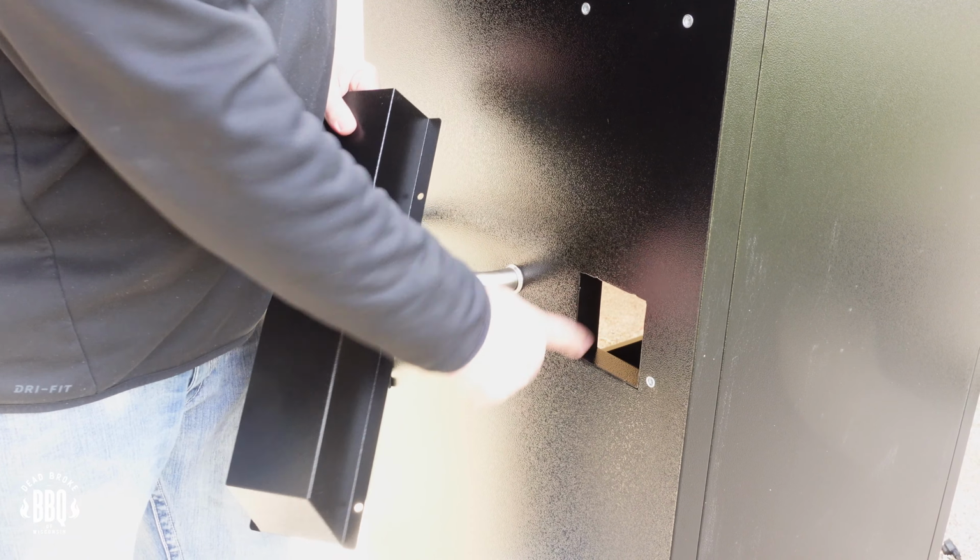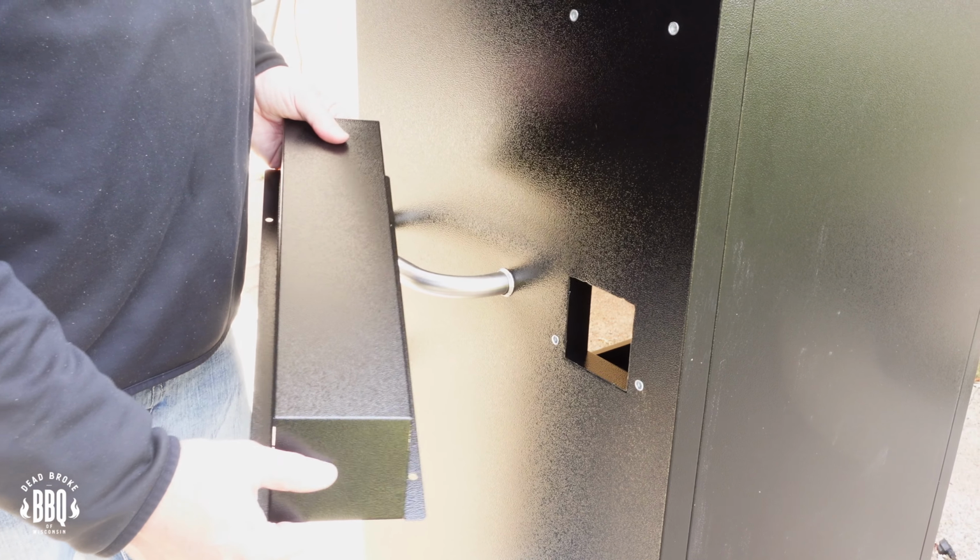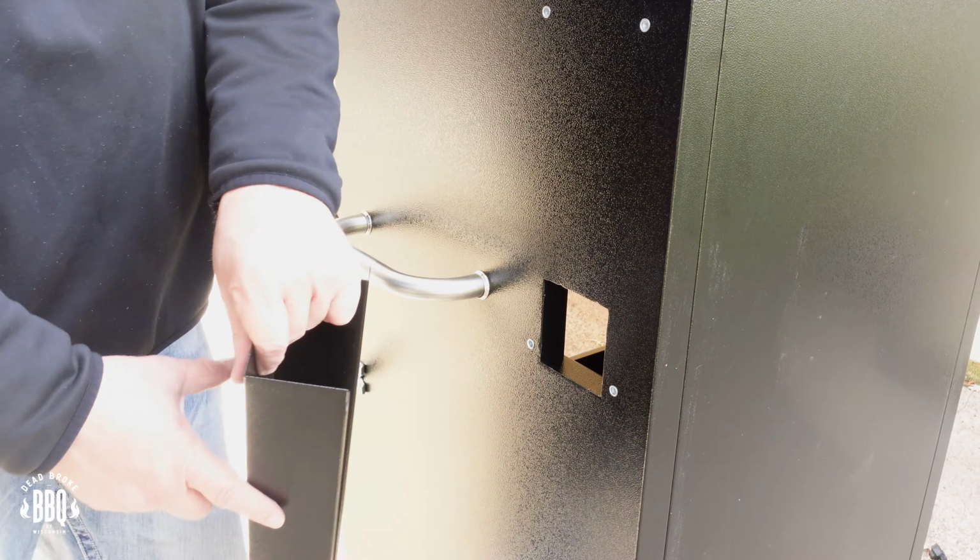Now here's the hole from the chamber, but you want to make sure that you have the closed end part towards the bottom, because here's the top of the vent. After you get them all finger tight, just go ahead and give them a good snug. Now on the dampener part, make sure it looks like this and your bolts are gonna go on top. Same thing, just get her lined up and start tightening it up. And we'll snug this dampener up a little bit too.